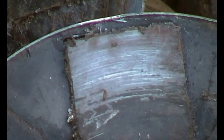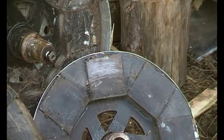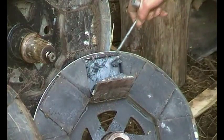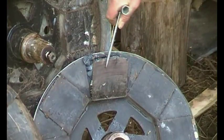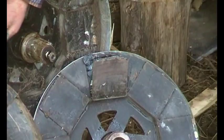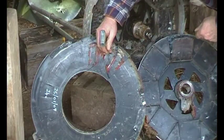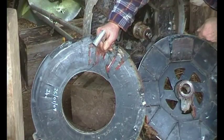And that's the one that's loose. So the damage to that - let's just show you how loose it is. And it's cracked. So that has been rotating and rubbing on there. See those lines? It's been wearing through there, these rotary lines. And it's actually started to wear through the insulation. I'm going to have to get really quite close in there to see what's going on, and whether or not the copper has been exposed.